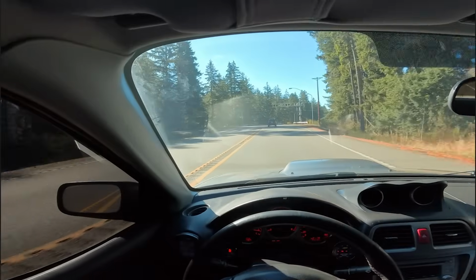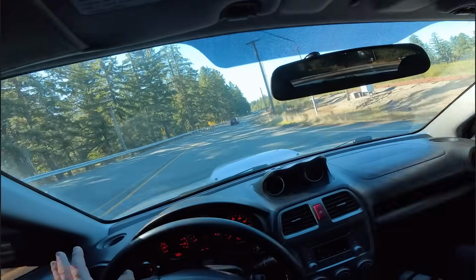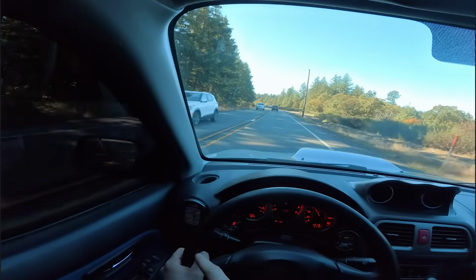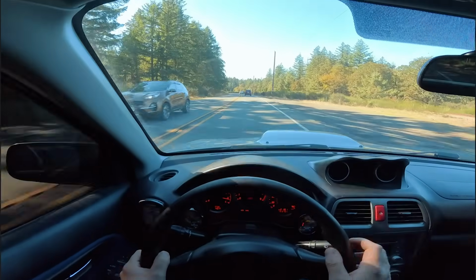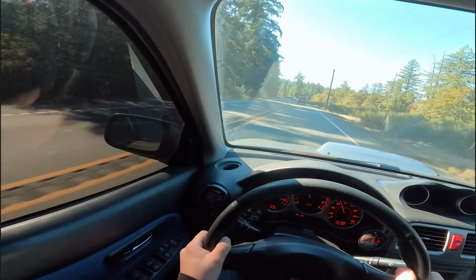Pump gas is the one where we have to be a little cautious of what we're doing with the car. Once we move to ethanol, man, we can try to get a little bit more rowdy, because ethanol is the one that's going to give us that extra safety cushion. Dude, this car is right there. I just saw it pull 2 degrees less. Same RPM, right around 3,200 RPM, same load range, everything the same.